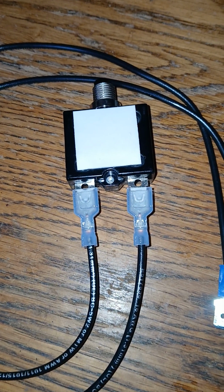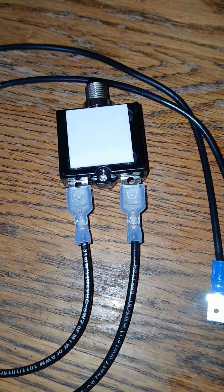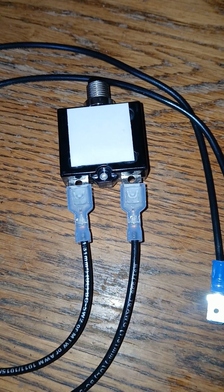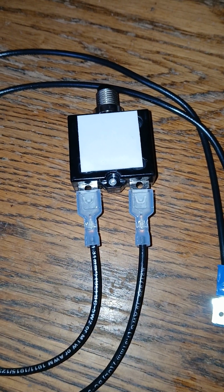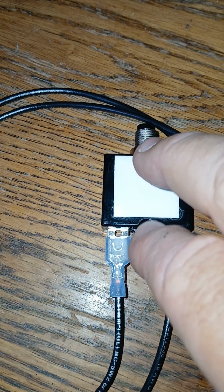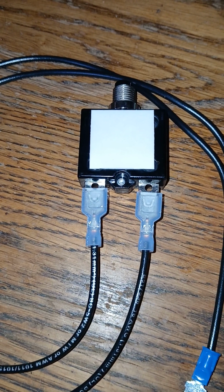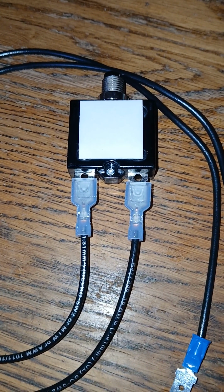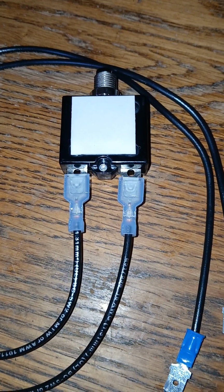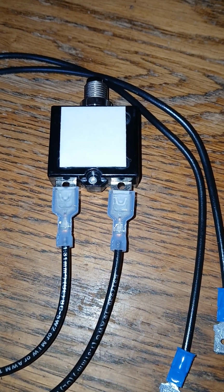So once we've done that and it keeps popping, then at this point one may be down a rabbit hole and wondering, well, what's the problem? The problem could be a short. So a wire somewhere along the system, the insulation on the wire could have gotten broken. It can be touching a piece of metal, etc. So then one, if they have terminal strips or wherever the wires come in, whether that be for the condenser wire, this and that, at this point, one would just have to start isolating.